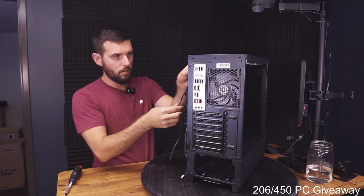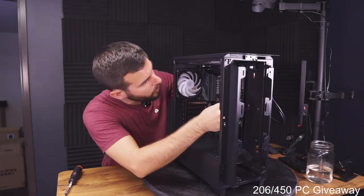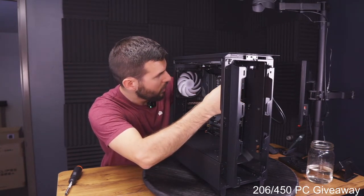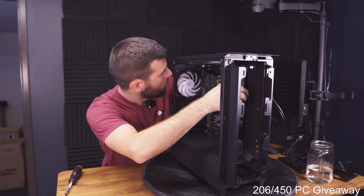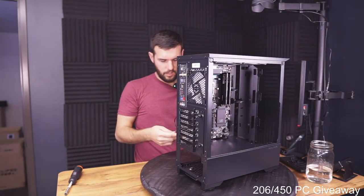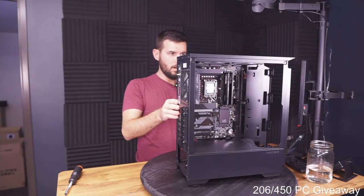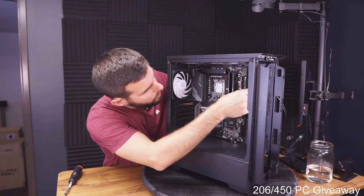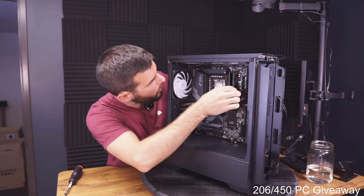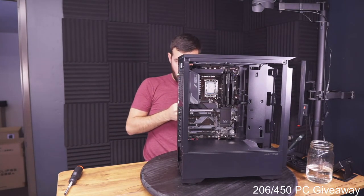This one over here? Oh, that must be the one from the front. Okay, so let's see what we got for chassis fan headers. Oh, we have two over here. So we're gonna use one of those, like that. Yeah, I like to just pre-do it. Got another chassis fan header right here. Okay. That one, and the rear fan header is right there, so let's do that too.